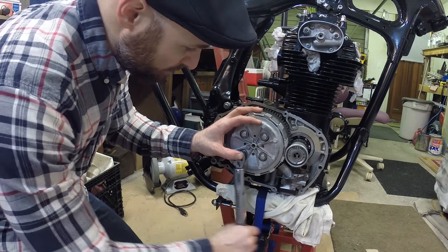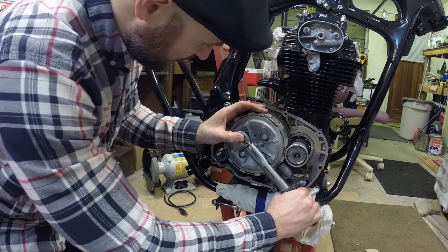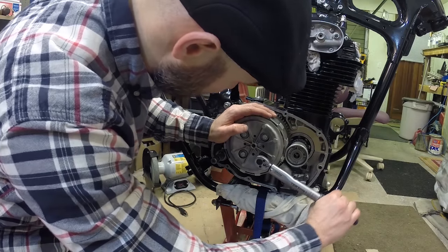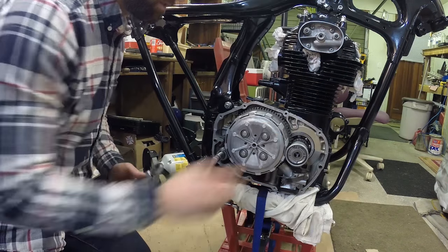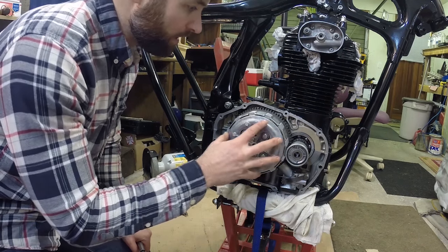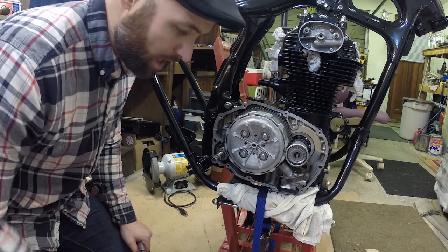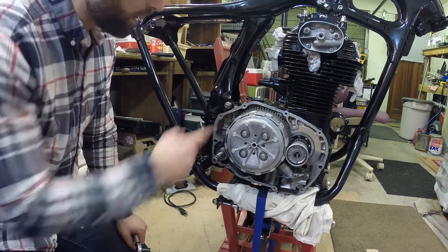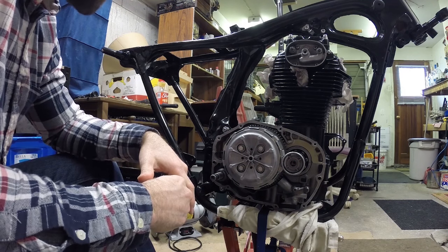I'm working in a cross-patch pattern, slowly bringing them up to six foot-pounds. It feels a little bit loose, but I feel like with the adjustment on the clutch — the push rod — it'll tighten up a lot once I get the other side cover on. I'm going to move on to getting the cover on here next. This has all been torqued to six foot-pounds. I'm going to go ahead and put the gasket in place. This will only go one way — I tried it the other way and it doesn't fit. There are some locating pins here that are already in place in my side cover.